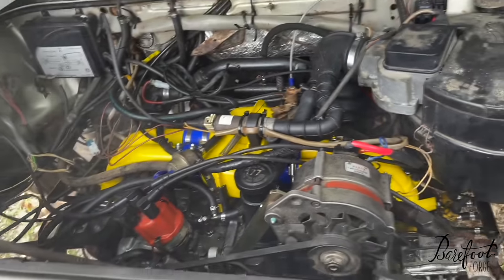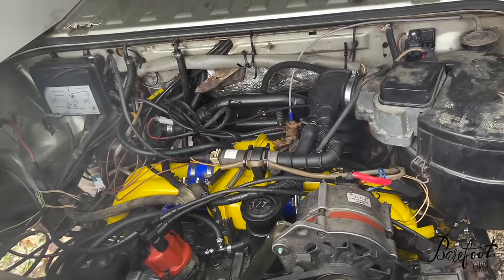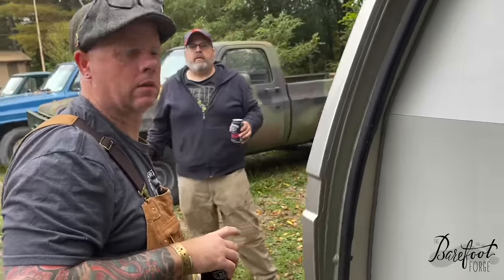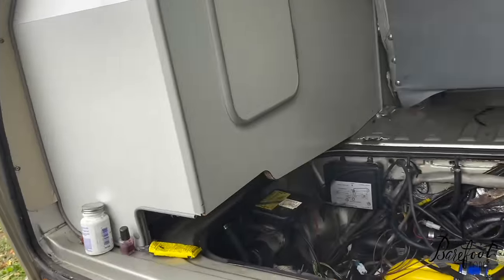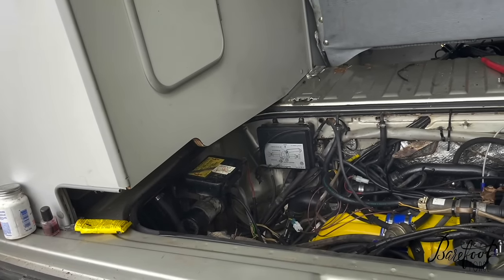I don't think we have pressure. It's not leaking. It's just where the antifreeze boiled over. What did you say, Kurt? We got oil pressure light and buzzer. We have an oil pressure. Is it buzzing or just the light? Buzzing. Okay. That checks out. Wiring. Interesting. Fire it up.